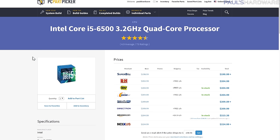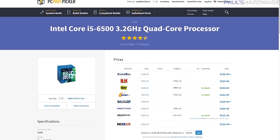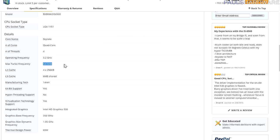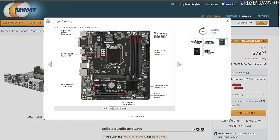For the CPU, which is probably going to be the most controversial choice, I went with an i5-6500. There are obviously other viable options for CPUs that are Oculus Rift ready, but I wanted a quad core and I like Skylake because it's new and it's got the best instructions-per-clock performance. Turbo will go up to 3.6 GHz. The 6400 is also a full quad-core CPU from Intel that could slot into this — it's about $20 cheaper, but it has a lower base and turbo frequency, so you won't get quite as much performance, especially with BCLK overclocking.